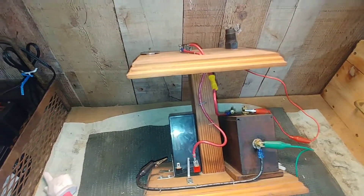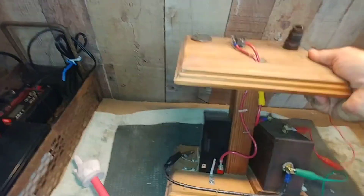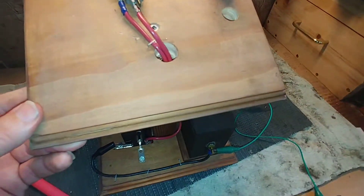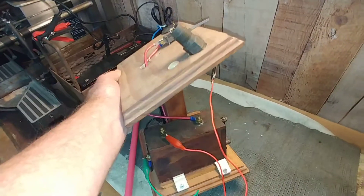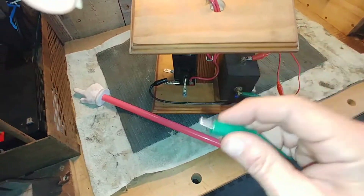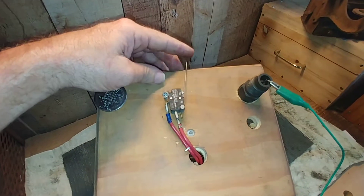So how I test a spark plug is with this micro switch right here. We'll hook up our battery alligator clip — okay, she's on there. Now, coming out of the Model T Buzz coil to the bottom of the spark plug is an alligator clip, just as if you're going to hook up a spark plug to run an engine. So what I do is put my spark plug in there, head down, and put my alligator clip on the back side of the spark plug. Take this green wire, which is grounded to the plug and back to the battery, put that on the bottom of the plug, and hit this micro switch and we should get a spark.